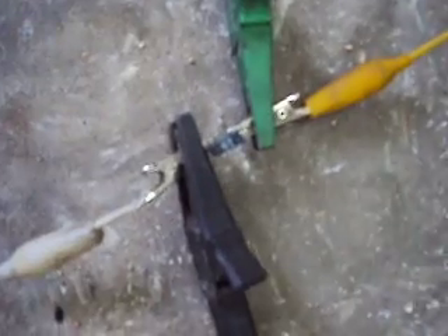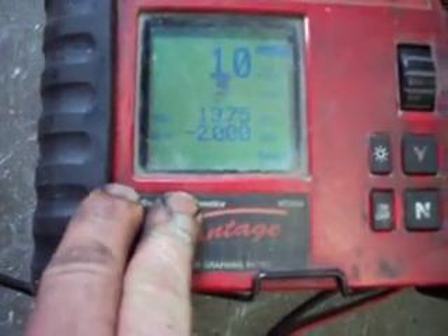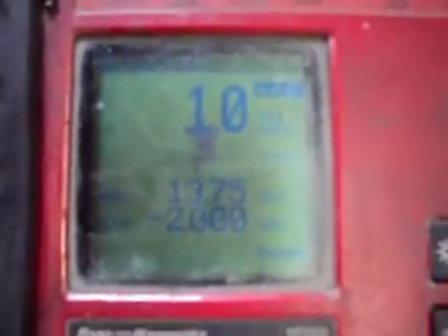That's a pretty minute amount. I'm not sure how accurate this is. If you're checking parasitic draw, this Vantage has a built-in amp meter and you could try pulling fuses, but a lot of cars nowadays you don't want to start pulling fuses because you automatically upset everything as soon as you pull a fuse — especially when you've got something like a body control module or a radio that may have several power supplies. Pulling a fuse sometimes just leads to more confusion when you're trying to figure out what device in the vehicle is actually pulling the battery down.